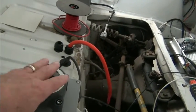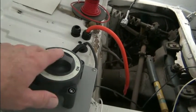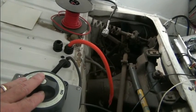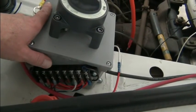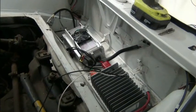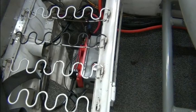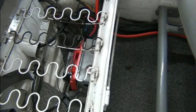So when we turn off the switch, we disconnect the battery from everything — from the charger, the DC-to-DC converter, everything. Power goes basically from the most positive cell to here, and that has to be as far as you go when the switch is off. For this box here, we still have to connect the ground — that's there to remind me. We still have to mount these two in place; that's where they're going to sit, but they need to be mounted. So we're close. We've got to run the cable that's going to come from the DC-to-DC converter back here to the battery.